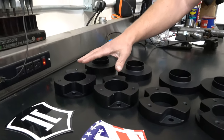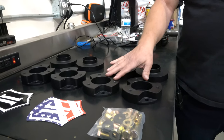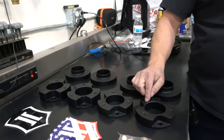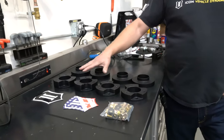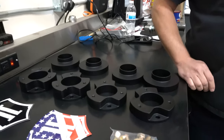These are the rear top load spacers, and these are the front top load spacers. The fronts are shorter because it's independent suspension — just a little bit of change here is going to make a lot more change at the wheel. That's why the spacers are different front to rear, but we end up with the same amount of lift when we're all done.